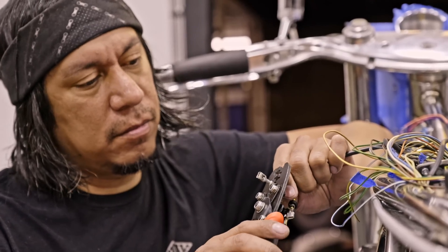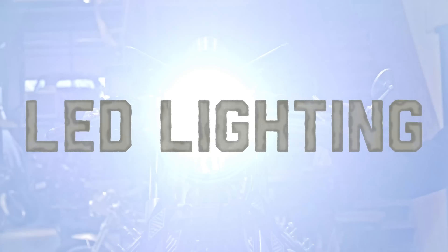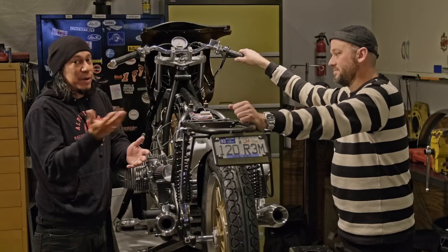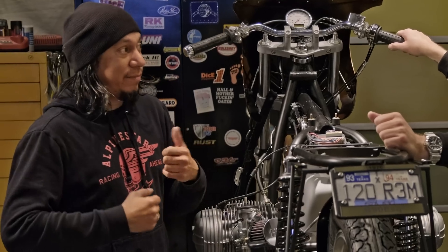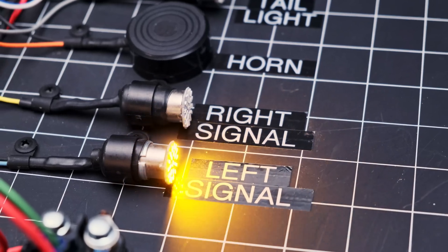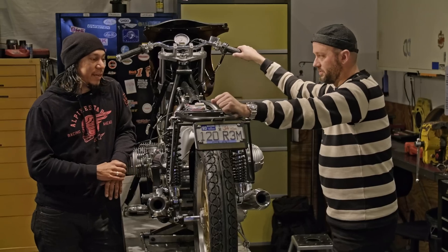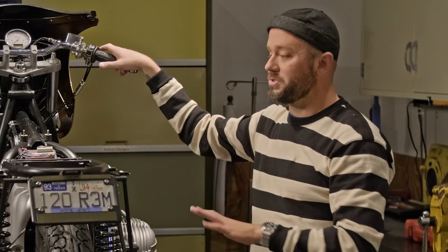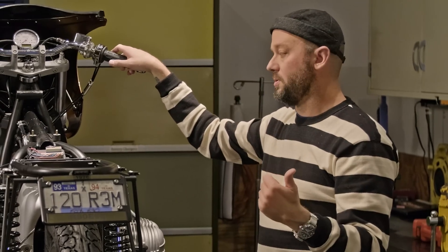Even for something simpler, what do you know now that you didn't know years ago? It's a lot more simple than I thought. We can get into LEDs versus incandescent bulbs and resistors, because as people probably know, if you want to put LED turn signals on your bike and it's not set up for it, they blink fast — because of how the relay controller works. If you want to do something as simple as upgrading your lighting, you may not need to rewire your whole motorcycle, but there are still some subtleties to doing that.